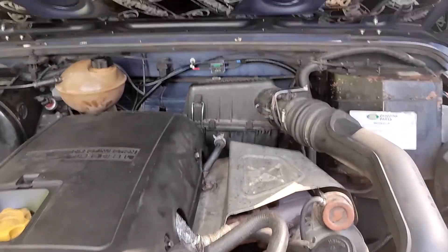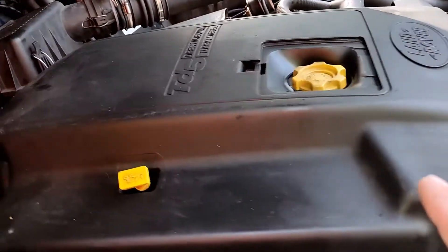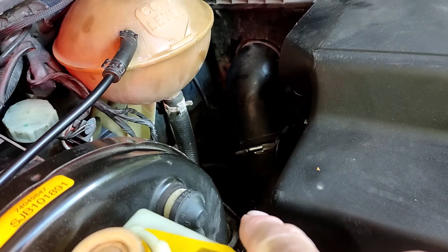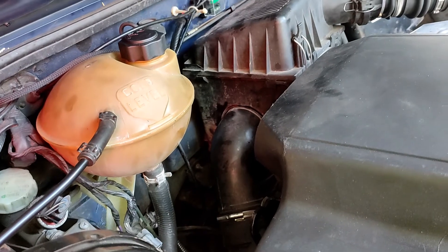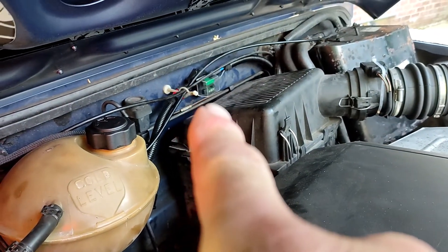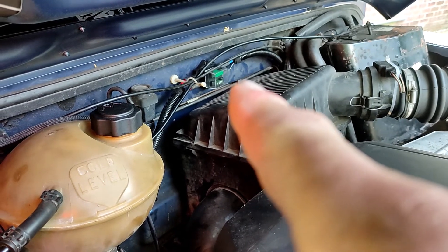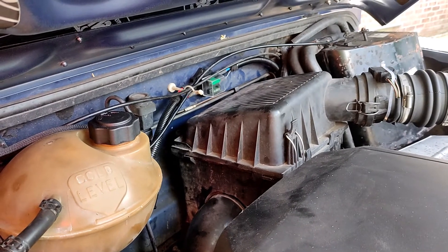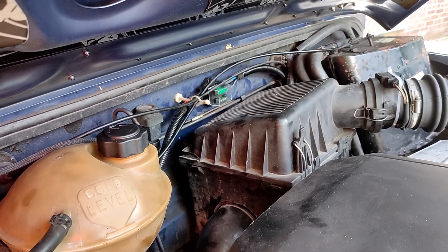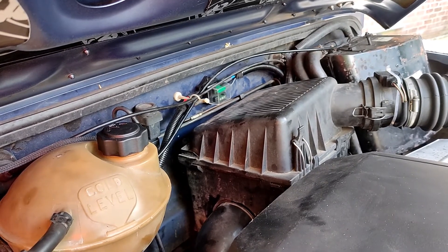In summary, I've taken a feed from the alternator down under the cover, running along with the rest of the main engine loom behind the engine. The main loom goes across the top of the gearbox and into the battery compartment on the passenger side. My loom goes up the bulkhead to a two-way fuse box — one fuse for main beam and the second fuse for dip beam — via the modification I described earlier, by cutting the main fused 12-volt line that goes to the two relays where it loops from one relay to the other.